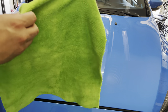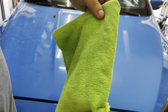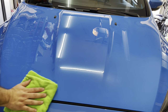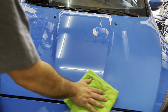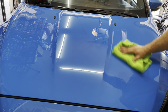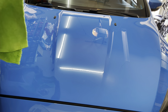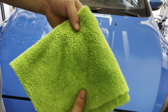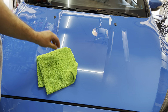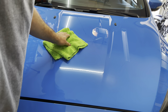I'll use a dual-pile type of towel — I'll use the short side here for the removal part. Let's go ahead and wipe right over it — boom. Flip the towel, then I'll use the long pile side. The key here — this is very important — if you wipe any product dry like this and you start dry wiping, you're going to have static.